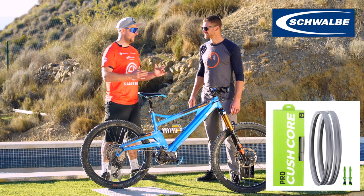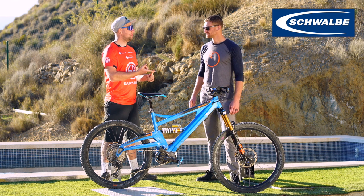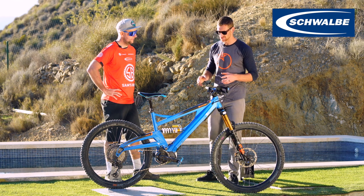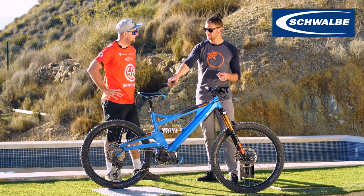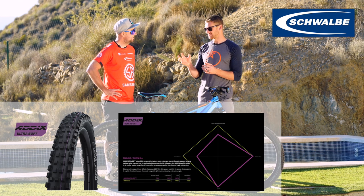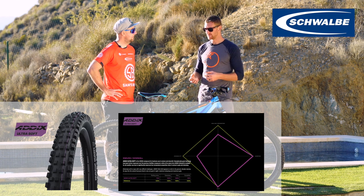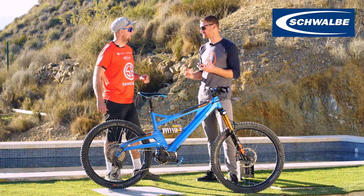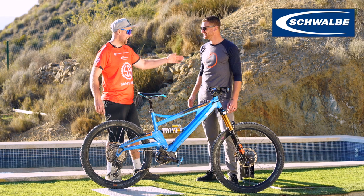You were saying in different riding conditions you change your tyre setups — so what would you do for a downhill race in terms of tyre setup and pressure? Good question. For EWS E, which has timed runs on downhill sections, I would go as soft as possible. I'd take the Big Betty off and replace it with a Magic Mary ultra soft compound. Really? Yes — it's an ultra soft compound, not designed specifically for that, but I did it during EWS E this year and felt great. It gives more suppleness and loads more grip, but after two days of racing it was ruined from the extra load and torque of the e-bike's weight. I did see Danny Hart running that ultra soft front and back setup too.